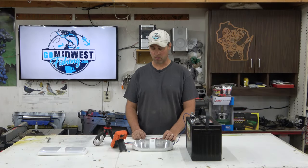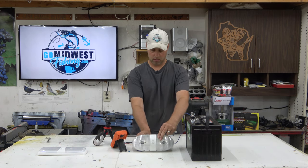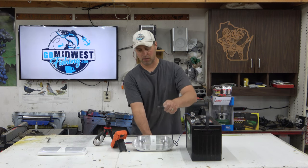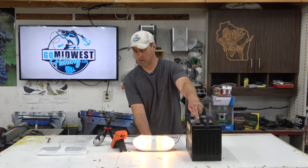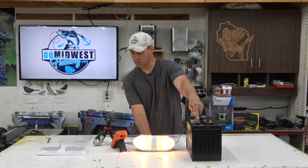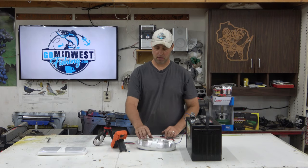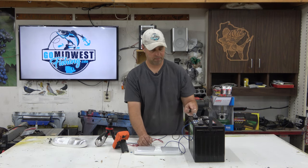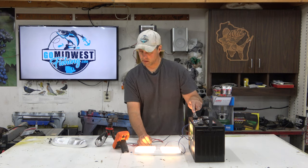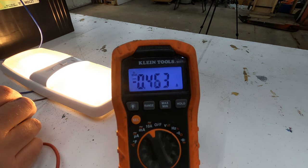We're in my shop now — going to do a little bench test. I've got my voltmeter hooked up to amps and a 12-volt battery hooked up here, so now I just connect it and see what it draws. This is the original incandescent light that came out of the camper. Plug it in and the voltmeter is reading about 2.8 amps, which is quite a bit. Now let's hook up the LED — it's running at 0.46 amps, which is way less.